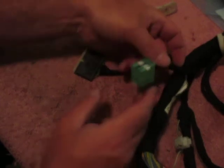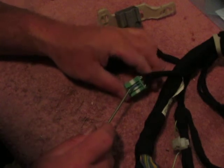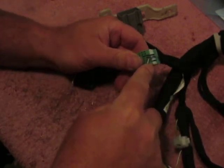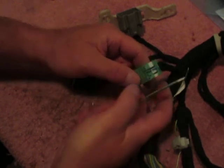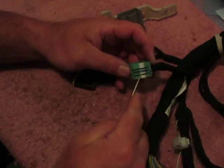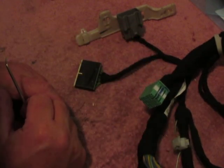The only other thing I wanted to show you is when inserting the BCM wires. Here's a BCM connector — here's this white part on the top, also called a secondary terminal lock. There's a little divot in here where you can get a pick in. Shove it in and pick it up and you'll see it comes up about not even a sixteenth of an inch, but that is enough for you to insert the terminal at the back and get it in there easily. Once it's there, snap it down and it goes back flush — so that's basically locked and unlocked.